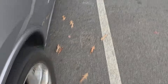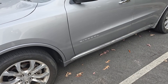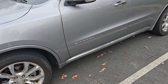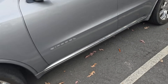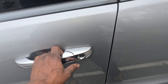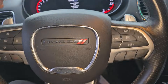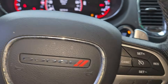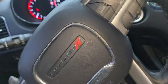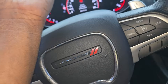This is a Durango. Y'all know the history on that Durango — that cooling pipe underneath that crushes or ruptures into a hose clamp. In my opinion, the engineers may have dropped the ball on that one. But I'm a mechanic; my job is to figure out why this thing is overheating and losing coolant. So I'm gonna take it in the shop and do my job.